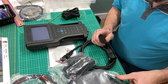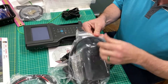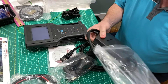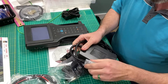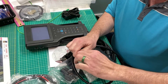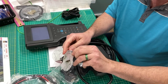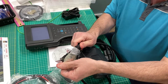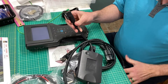If you need to put your CAN module in, you plug it into this cable and the end of your CAN module goes in line. My biggest question was: what happens if my car doesn't need the CAN module? Well, apparently if it doesn't need it, it'll just pass through — so you can put the CAN module on and leave it on no matter what car you're scanning. My Grand Prix doesn't require it because it's not a CAN bus system, but the '08 Equinox and the HHR we just got will need the CAN module.